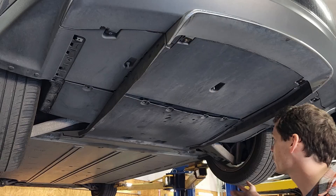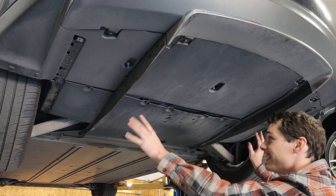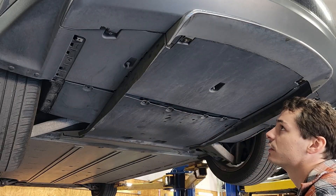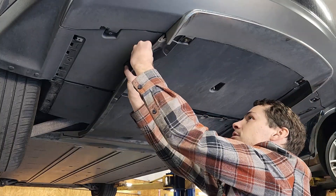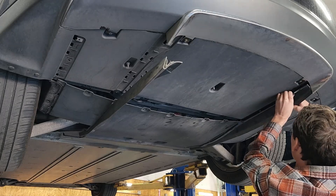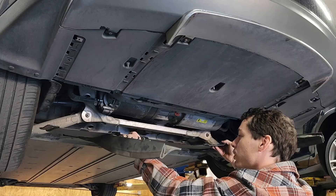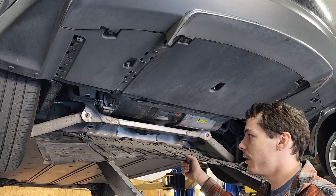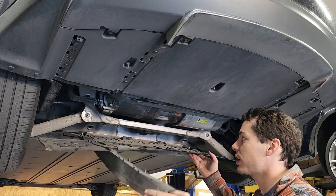The way I like to do this is to actually leave the screws in here on the front edge of these long fins and leave them clipped into this piece. That way all of the screws are out but it's still attached. If I just bend these towards the outside they'll unclip from the bottom side of the bumper, and then we can pull this down around the cloth fender liners — and now it's just hanging here. If you're just doing an encoder sensor check, you can do it just like this.